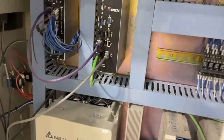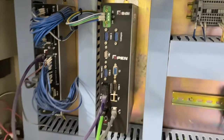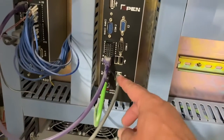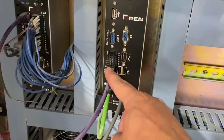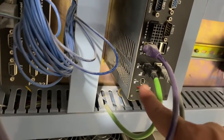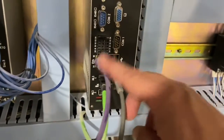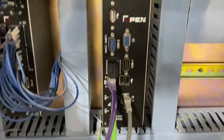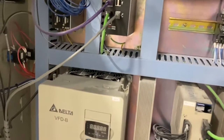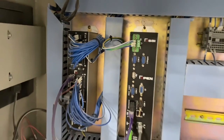She's all back in and we're about ready to power this up. Just a reminder why I take a video or photo of these cables — it's only four cables plus the ground underneath, but these are both Ethernet cables, so I could easily have swapped those out by accident. I also noticed this one has the same connector here and an identical one right below it, so I went back and referenced my photo to make sure it was the top one and that these colors were correct. Always a good idea to have those photos or video as a reference.